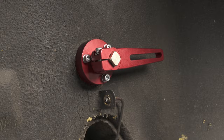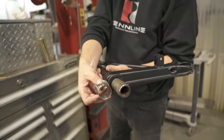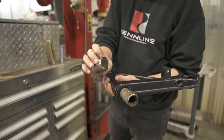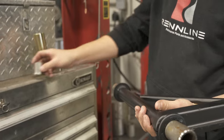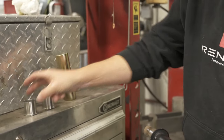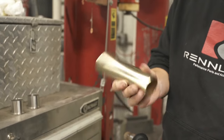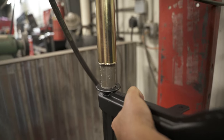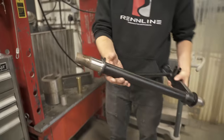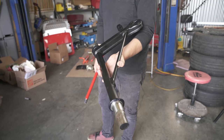Next I'm going to go to the control arms. We're going to install these sleeves over the ends — they've got a little bit of a spline on them so they won't rotate, and they're a press fit. These are prototypes we just came out with and the kit will probably come with installation tools like this. Let's go ahead and get these pressed on. Now we're ready to put the control arm back in the car.